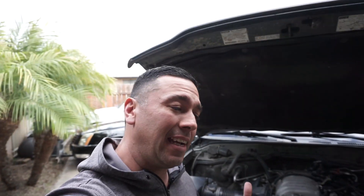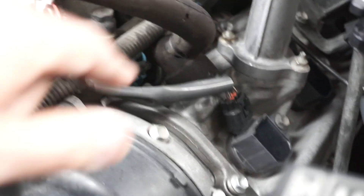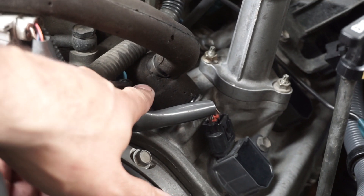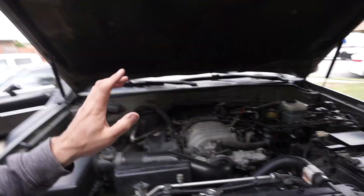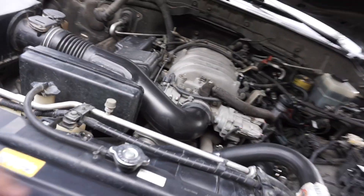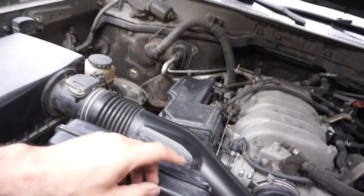Welcome back — it's the next day and we're going to tackle the passenger side. We already did the driver side as you guys saw. One thing I didn't show you guys is that I did add the PCV valve grommet cover on there. Everything on that side is plugged back in and should be good for another 80,000 to 100,000 miles depending on the valve covers. We also did the spark plugs. So we're going to go ahead and tackle this side. First and foremost, we're going to take out the air box to access it.